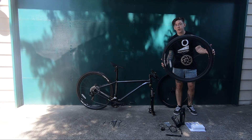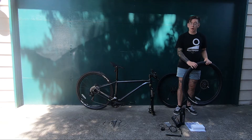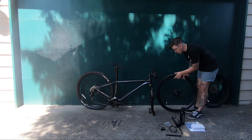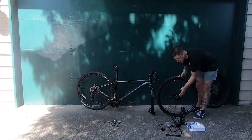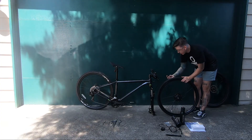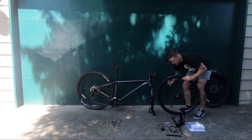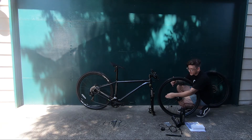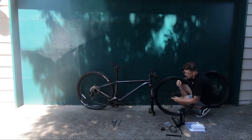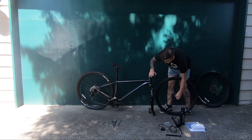This bike is a disc brake bike with a big meaty tire on it. We'll cover disc brake and tire installation if you want to swap it out in another video, but since not everyone will need that we're going through the basic steps. Grab your Hilltopper wheel — the hardware should already be in the right order, so don't worry about mixing it up. The only thing you want to pull out of the way are the little rubber caps to access the nuts. The axle is round but has two flat sides that fit into the U-shape of your fork — that's called the dropout.